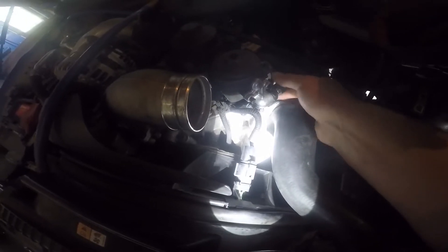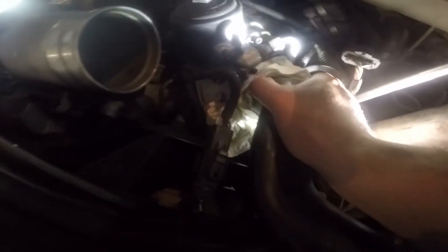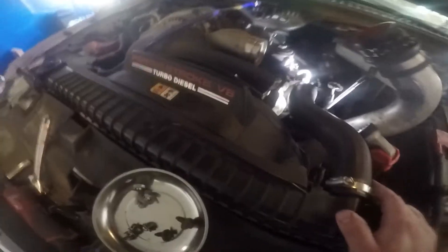Here's your fuel line — I just take an adjustable wrench and pop that loose. There are four T27 Torx bolts here. Press down on the hose to access the bottom right one. These are under spring tension, so when you loosen all four they'll pop out — be careful when you release them. Put a rag down to catch any fuel that comes out. I'll loosen the rest, show you what's in the blue spring kit, and go from there.